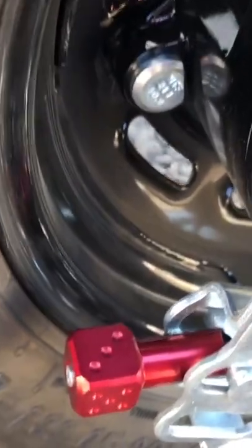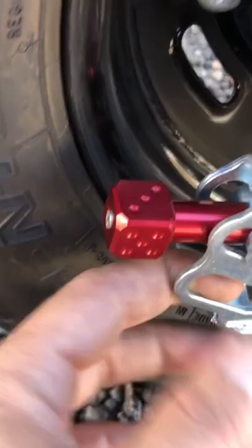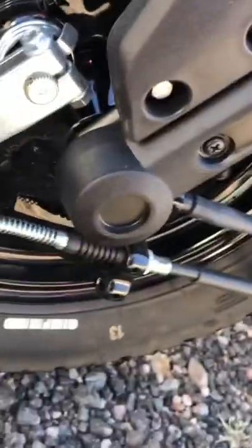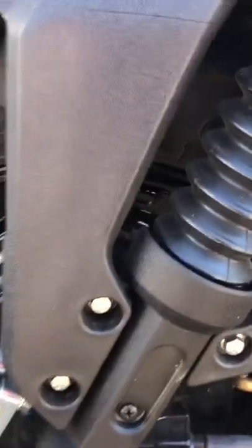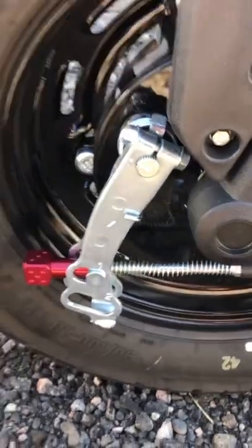There's plenty of length in there to adjust — no matter how stretched out your cables are, these adjusters are still going to work for you. I didn't bother putting the bottom one in for the video since I'm not reattaching the linked brake system. For the front one, even on the center stand it's on the ground, so just push up on the handlebars to pick it up, have somebody help you, or put a block of wood up here while on the center stand to lean it back on the rear wheel so the front wheel is off the ground. Then just roll it by hand, make sure it free-rolls, and adjust it to the point where it starts to grab.